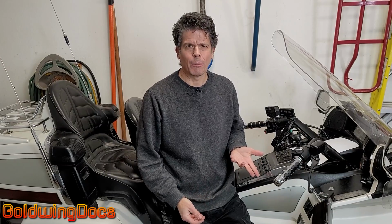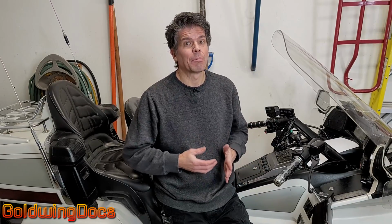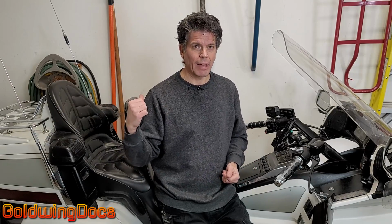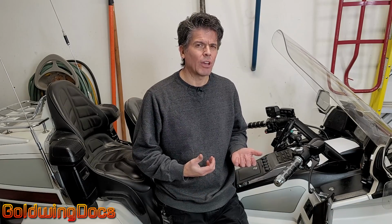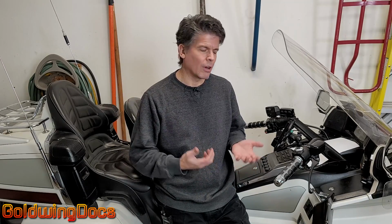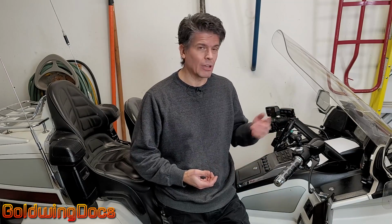So why do we even care about this? Well, tires don't last forever. They start aging not from the day you buy them, but from the date they're manufactured. I've actually bought tires that I had shipped to my house, and when I received them, they were almost 5 years old. I sent them back. You really shouldn't be using tires that are older than 5 years on your motorcycle. I know this one here is getting close to 5 years now, even though it's not used up.